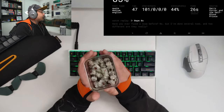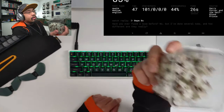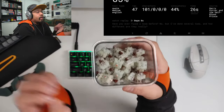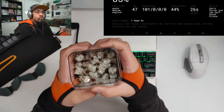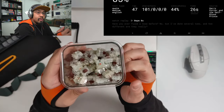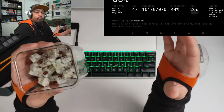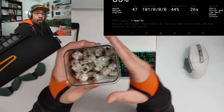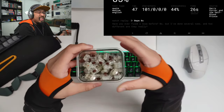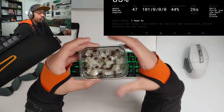I've noticed with gaming switches, these came from a gaming keyboard similar to the Ducky 1-2 Mini. The difference is with gaming switches, they aren't lubed, and a lot of gaming keyboards come in hollow. So any of the issues you would have with the switch, and this is your base bog standard switch, will reverb right through the case. There's no foam padding, no tape mod, no nothing. So if you want to fix the sound of a board, even just tape modding it might actually help, even if it's just a gaming keyboard.